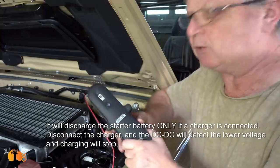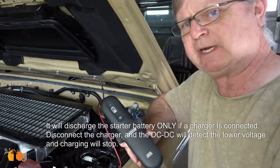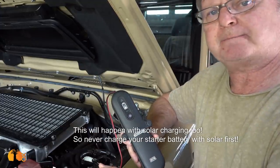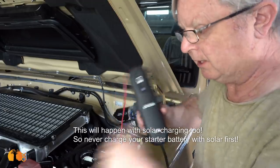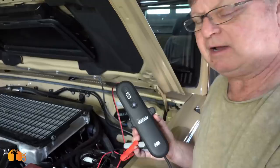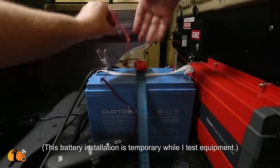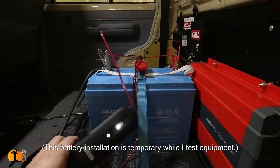So if you're going to do this, it will charge all your batteries — but if you interrupt it halfway, there's a very good chance, and it's happened twice to me, the car won't start. So now what I will do is disconnect this, and you will see the charger turns itself off. I must connect this directly to my auxiliary battery if I don't want that to happen. Or if you want to do this and you don't want to disconnect stuff, charge your auxiliary batteries first, then come and charge this.